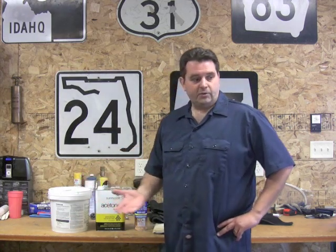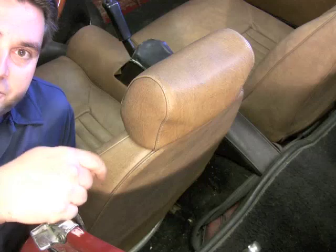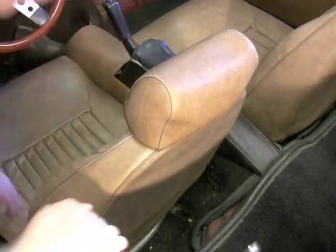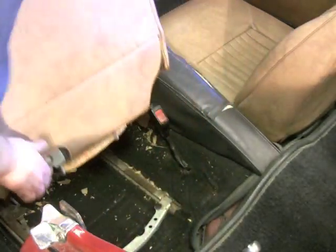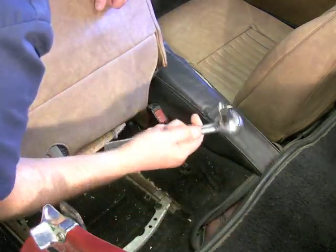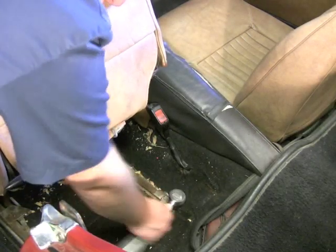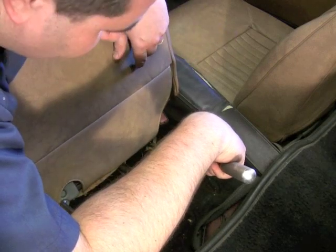The first thing we need to do is go over to the car. Slide your seat all the way forward — there's a little latch in the back that you can flip and your seat will flip forward. Once you do that, you'll see two bolts in the back inside the slide arm. Use your 7/16 inch wrench to take those bolts out, then remove the two bolts in the front as well.